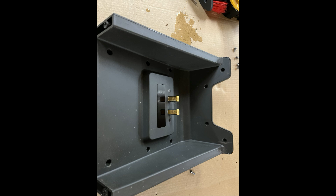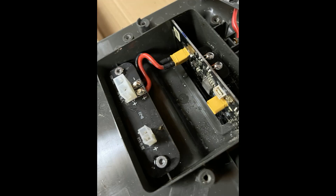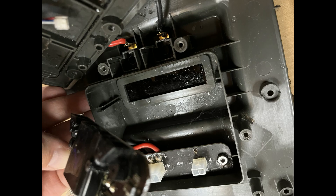Already now, I started to see what was wrong, as the cardboard I was working on got wet. After removing the last six screws, I could open what was supposed to be the watertight compartment for the electronics — it was full of water. I could actually pour out some water, and everything was wet. I could even see corrosion on the LED and other places on the PCB.